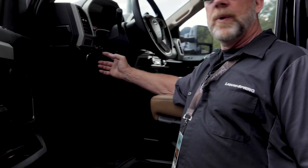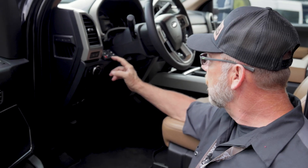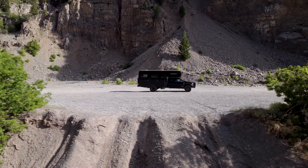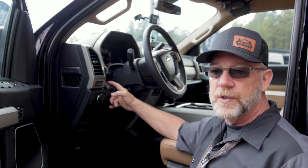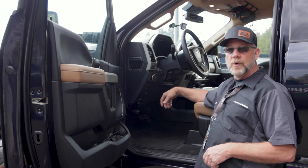In the cab we have a small touch pad, and on one side we have ride modes — comfort, normal, and sport mode. In comfort mode we're going to be less aggressive about changing the spring rate, where sport mode is going to be most aggressive. So if I'm out on a windy day or in very windy corners, I'm going to put it into sport mode to give me the most control driving the vehicle.